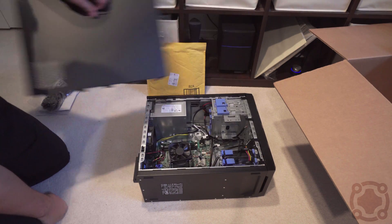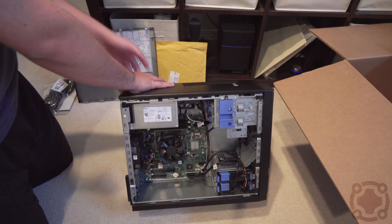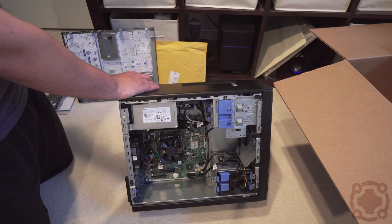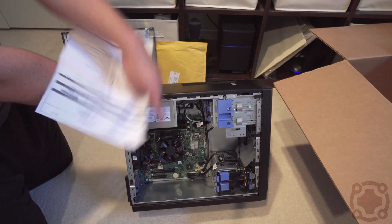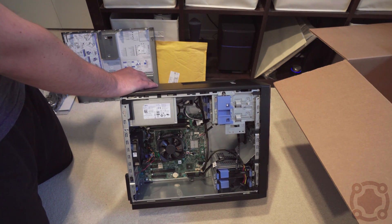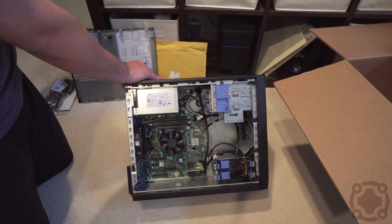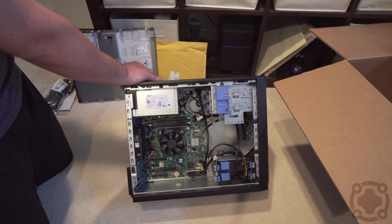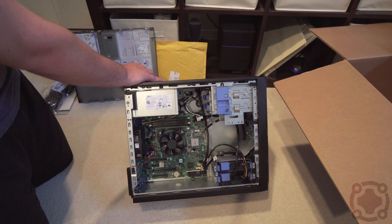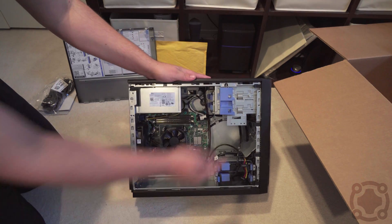Here's the inside of the server — very basic. Here are the specs: it has an Intel Xeon E3-1270 v5 processor at 3.6 GHz. This is almost top-of-the-line; the next one up is the 1280 but that was going to add about $300. It came with only four gigabytes of RAM, which I'll be replacing, one one-terabyte hard drive, the iDRAC controller, and the TPM 2.0 chip which handles cryptography — which was interesting when I researched what it actually does.